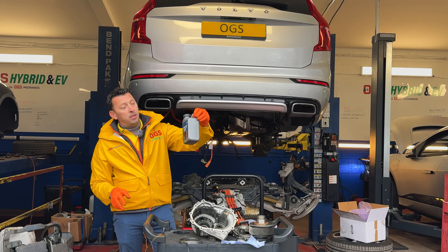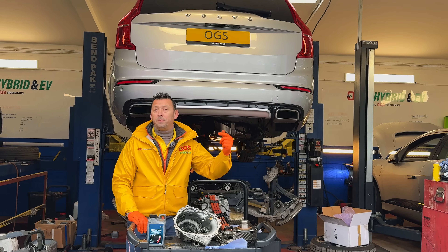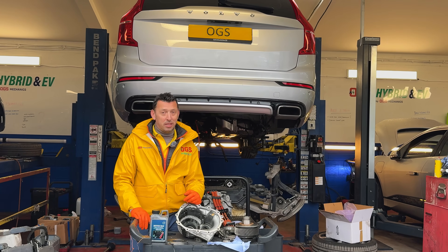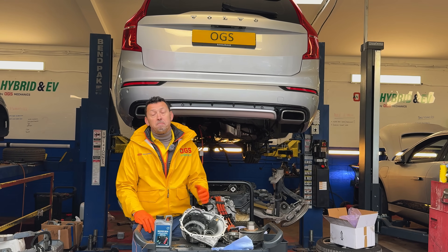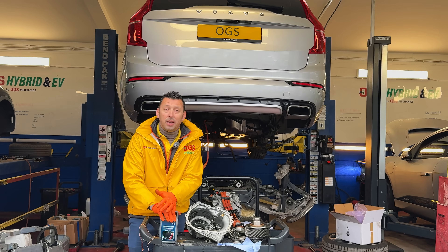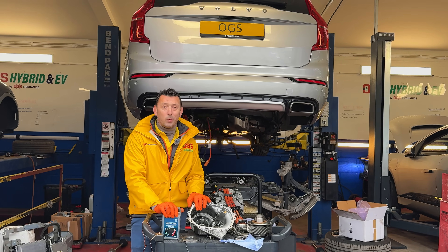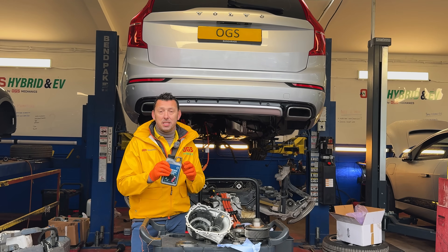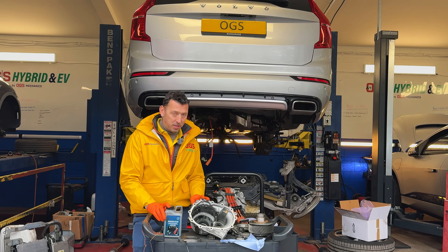The unit should take 0.8 litres — not a big quantity. It's been reportedly found that sometimes when vehicles were drained there was a lot less oil than 0.8 in the diff. So it could be that from the factory they left with a lower amount of oil. We've seen some threads talking about that. Obviously, leaving it as a lifetime fill is going to guarantee failure of the ERAD. When should it be replaced? Because it doesn't cost much and it's not hard to access, I would say replace it every service. It could definitely extend the life of the ERAD system.